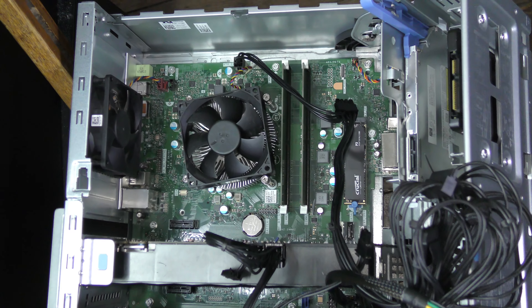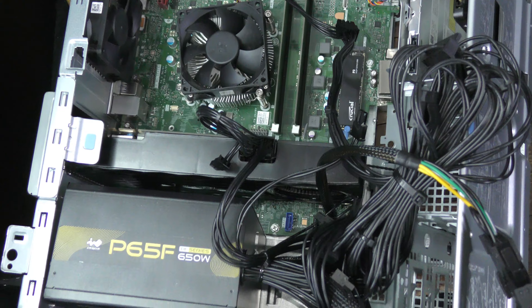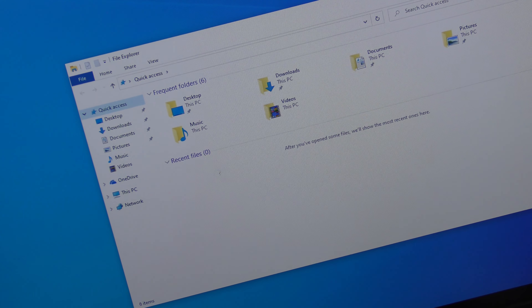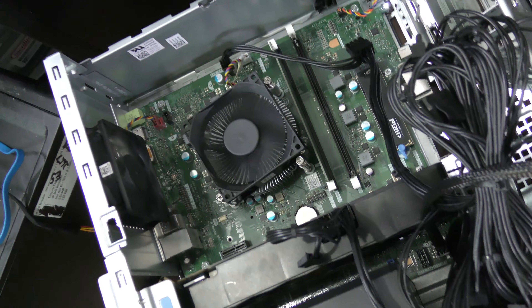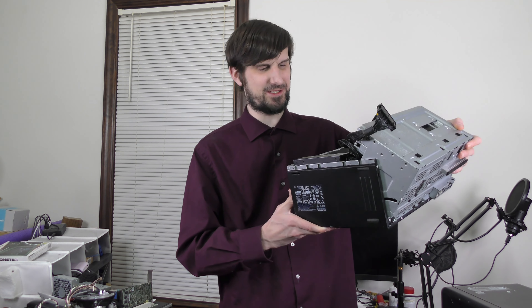Everything's installed and we at least have our temporary setup — and while I've seen some nice cable management before, this is truly a thing of beauty. The question is what went wrong, because something probably did. Success! Mostly. For whatever reason it wouldn't boot with that extra stick of RAM in there — no beep codes, just a black screen. As soon as I removed it, it started working and I was able to do the install process. I tried re-inserting it after the install — same thing. So we at least got it running with 8GB of RAM and I'll have to figure the rest out later. Everything else seems to be perfectly fine. In the next video I'm going to try to get this to the point where it at least might kind of close — though you know how my plans tend to work out.